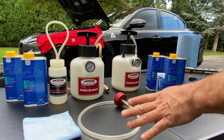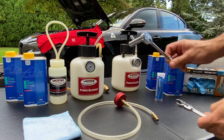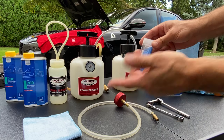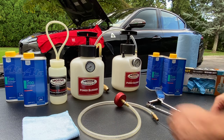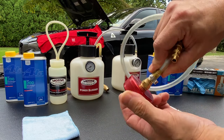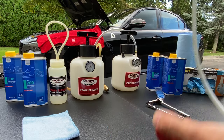So let me show you what we're working with today. For the Alfa Romeo you're going to need an 11 millimeter flare wrench, and I have an 11 millimeter on a quarter inch drive just to break them loose. These are paint touch-up dabs — I'll show you this in the video. We've got a clean towel and our ATE Type 200 brake fluid.